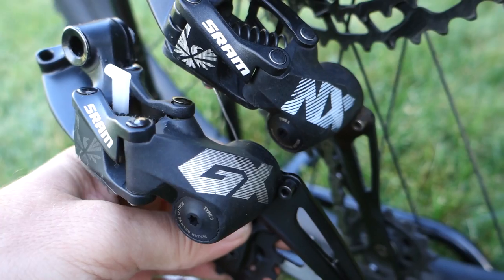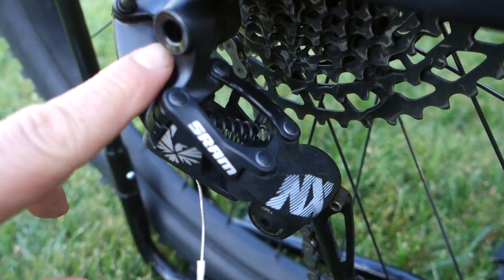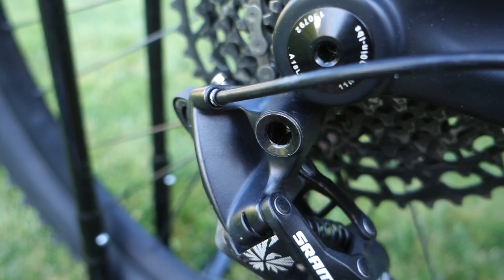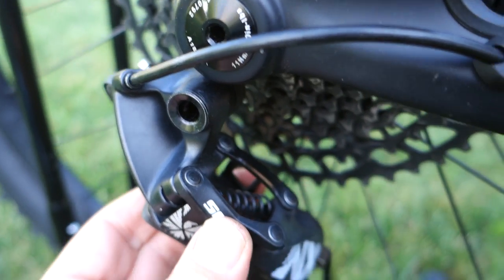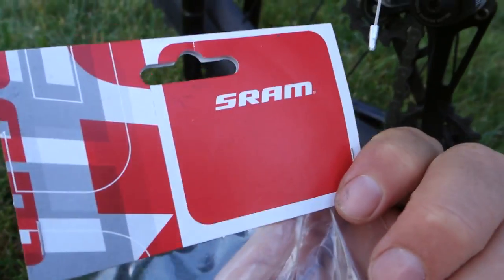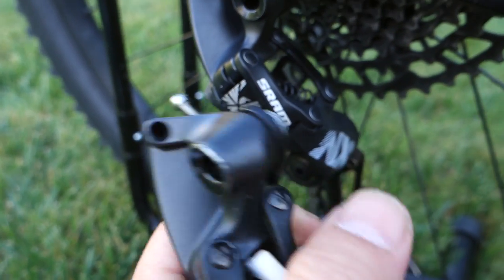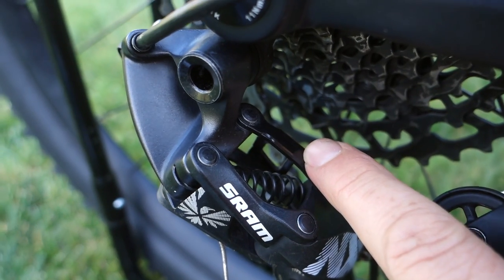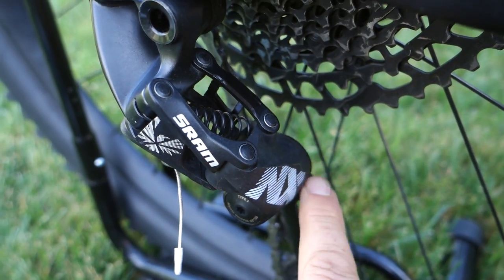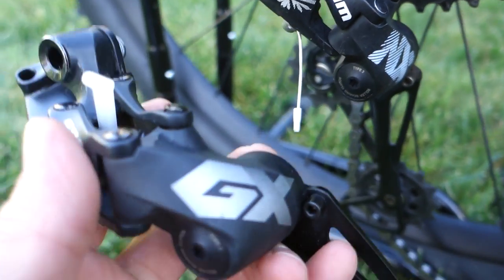The derailleur — aside from the graphics, there are a few other differences worth mentioning. It functions fine, as I'll show you later. If you look at the top, the two derailleurs are pretty much identical — the knuckle is the same. It does have a little bit of play in it, which is kind of normal for SRAM Eagle. If you want to take out that play, you can use the XX1 or X01 parts listed in the description. In the middle section, the front plate is the same; however, on the NX, the back plate is just stamped metal as opposed to something beefier. If you catch your derailleur on a twig on the trail, this is what's going to bend and likely make your derailleur unusable. So better build quality on the GX, for sure.